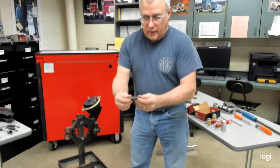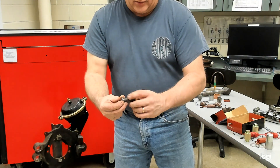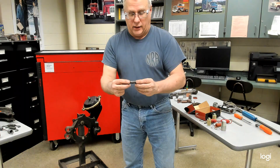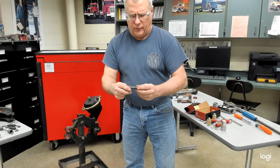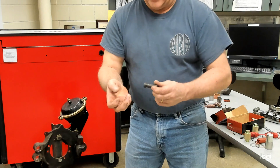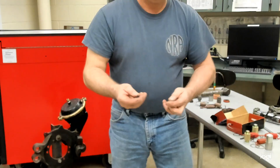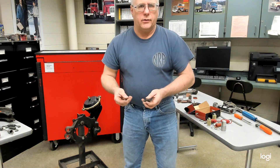The pins themselves, as you see here, have very large worn, stepped areas. They should be perfectly smooth, same diameter all the way end to end with the exception of the head. This one cannot be reused — on the back side it's even worn at a slight angle, indicating an alignment issue that had to be addressed. Once again, replace it: lost motion. The small pin on the automatic slack is also worn really bad. Cotter pins, which retain these pins, must always be replaced — never reuse them.